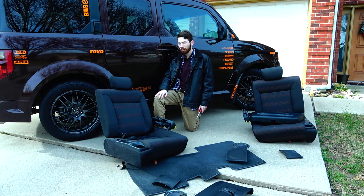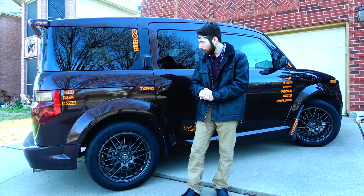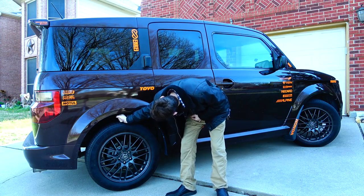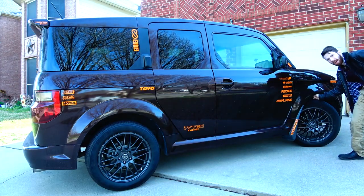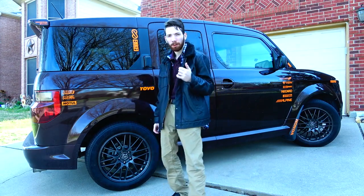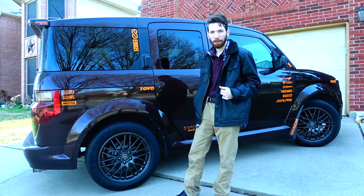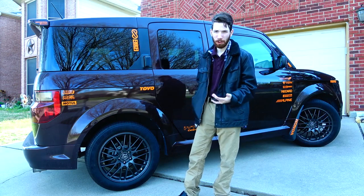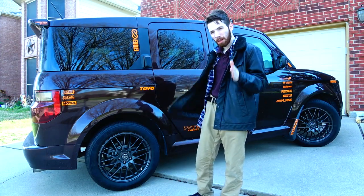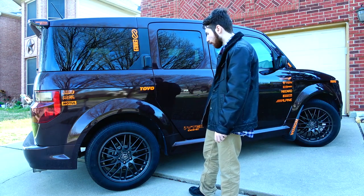We just removed some weight and I'm interested to see just how much faster it is — probably not a whole lot, but it's definitely going to be a slightly noticeable difference. I know there are some discrepancies with the ride height now — it's very minimal. The front is just over a fist to the wheel well, and the rear is a little bit less of a fist to the wheel well, so it might have gone up about that far. No biggie. And actually this is going to translate into better steering response, because more weight will now be on the front. When I do get my lowering coilovers later, I'm going to adjust the ride height to correct for that — they are ride height adjustable, stiffness adjustable. The camber is also adjustable on the front wheels, but I'm going to keep it pretty much stock, maybe just a little bit of camber for better grip in hard cornering.